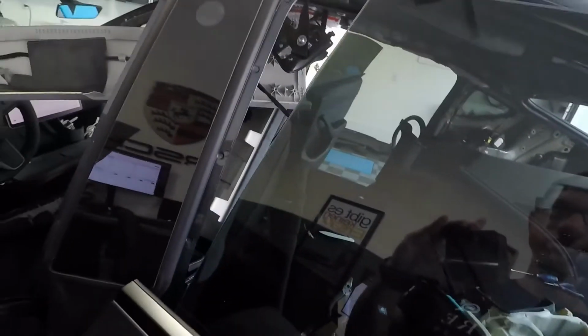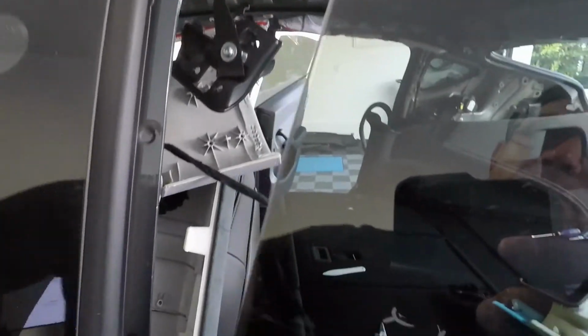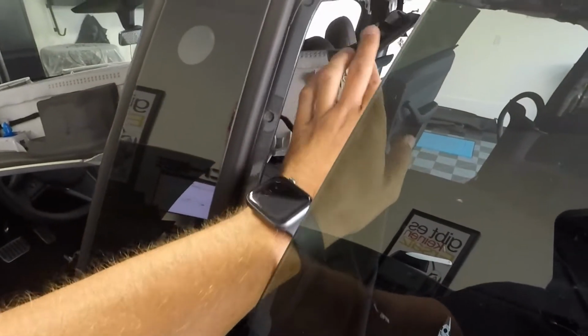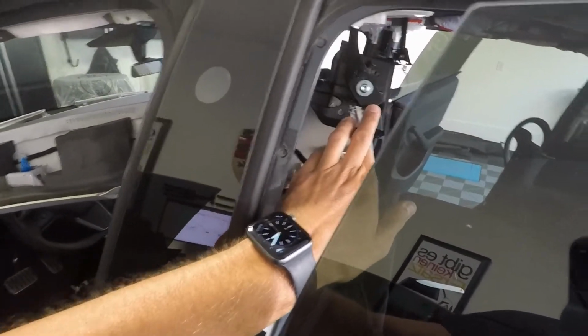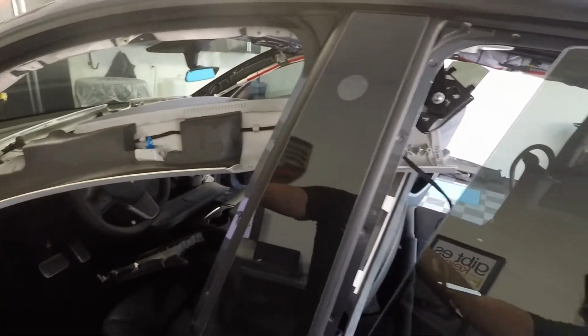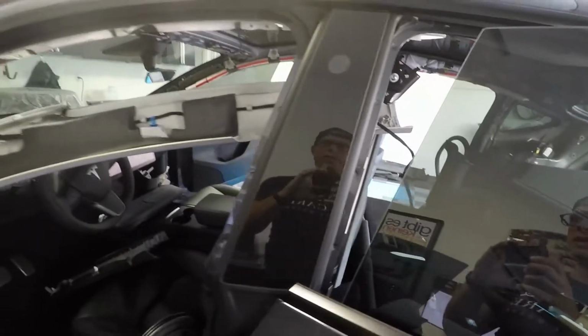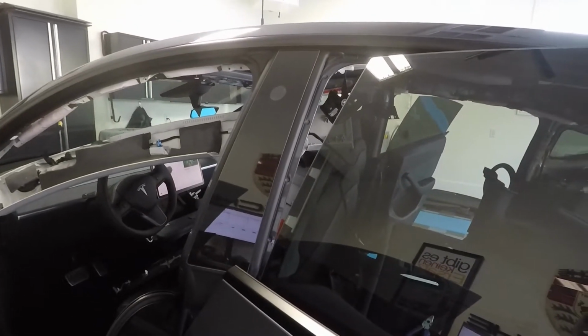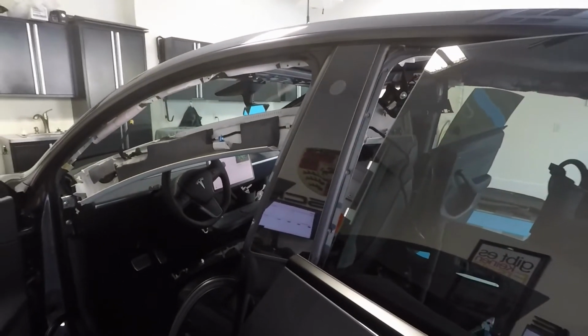I'll bring in the back headliner, and the front and the back headliner are actually attached together right here. So the back headliner will sit here and they screw together, and then this screws on as you screw them together and it hangs. So once that's all together on both sides, this side and the other side, then I'll attach those headliners and get them up and in. And then once that's done, I'll come back and I'll start putting the pillars in.